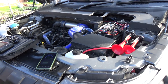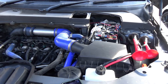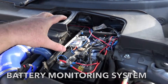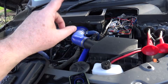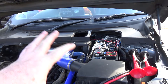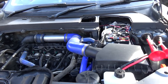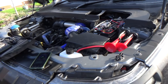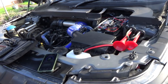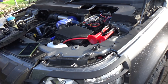In this video I'm going to look at resetting the battery monitoring module. It's this thing on the battery, but the software side is in the ECU. That's a shunt to measure the current coming and going from the battery. The calculations are done in the ECU as part of the battery monitoring feature. A lot of people say that when you fit a new battery you must reset the battery monitoring data — the learning data — so it can start learning the new battery without old data clouding the picture.